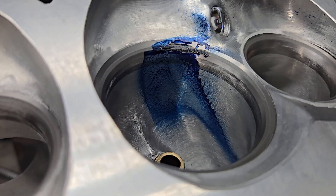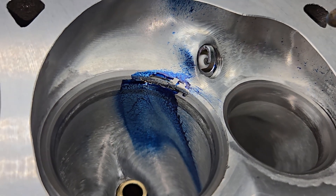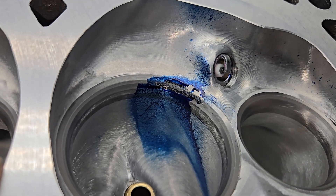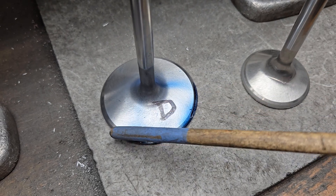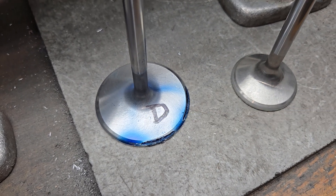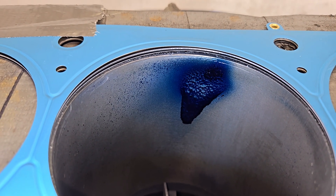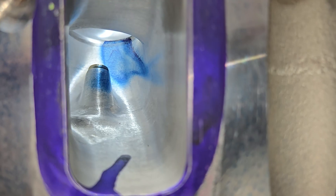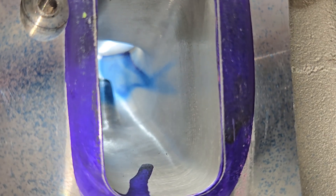As far as our liquid flow test, it looks really good — it goes all the way down the port. We've got a little bit of speckle action here, a couple little drips, not bad. The intake valve actually looks really good; you can see we've got dye coverage almost 90 degrees on this valve — that's fantastic. Taken at 750 lift, it has practically zero swirl, and you can tell by the angle of the dye. Take a look right down its throat — you can see how far back that dye goes.